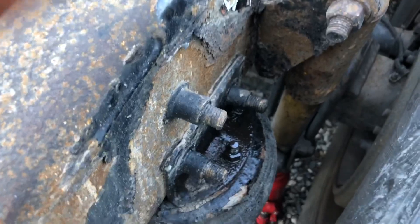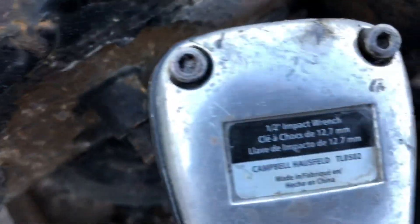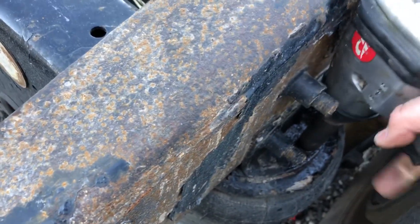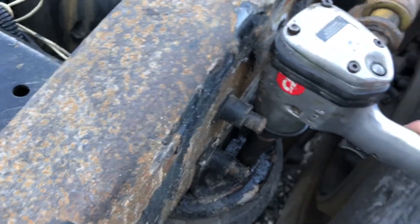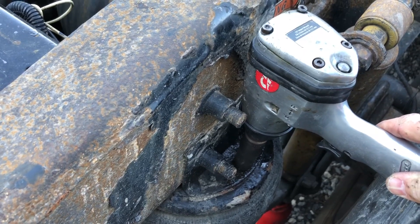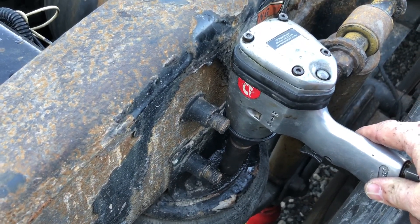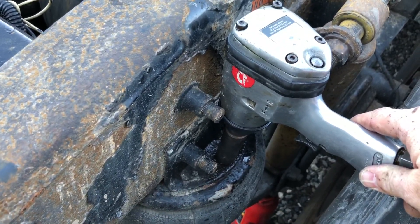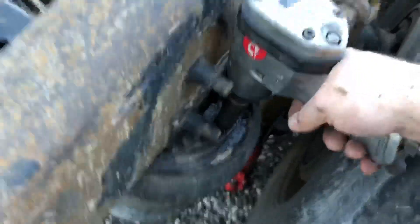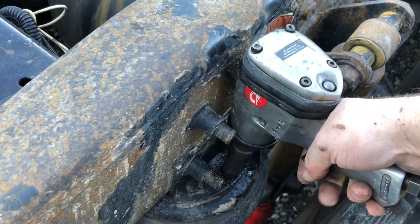I took a wire brush to the top of this nut. Just so everyone knows, you don't have to have anything large — I'm just using a half-inch impact. The reason being is if you have an impact that's too large, with too much torque on a smaller bolt or nut, you're taking a chance of breaking it. And when you break stuff, that can open up a world of hurt on you, especially on a Sunday when you can't really get parts.